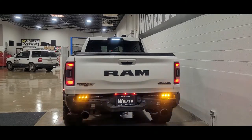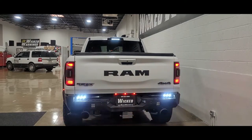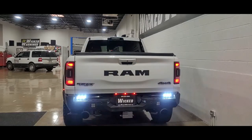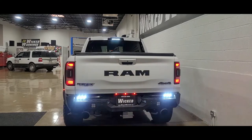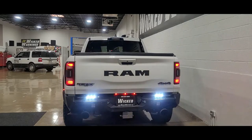As much as I wanted to screw around with the taillights and headlights, I simply ran out of time and on this build we didn't really need it. We went with our Thin-X strip right on that rear bumper — that's another ADD bumper in the back. It's got another set of Baja Squads in the back there for auxiliary rear lighting, and our 15.5 strip went really nicely right on the top edge of the bumper. This particular TRX has an all-plastic panel underneath the tailgate, a little different than most trucks which have a steel panel. I wanted to keep the lights bold and bright because these were the only two we were going with on the lower rear. The Thin-X strip is alternating amber-white and they are synchronized. Above that, we used our Auto Flasher kit — coming soon to the website — for the cargo light of the newer body Ram. We're exploring a lot of options, and this was one of the first ones we did here with the factory white cargo light. It didn't interrupt any factory function; the light works just fine and our Auto Flasher can make it strobe in a variety of patterns.